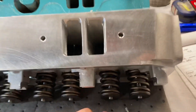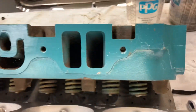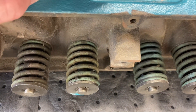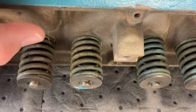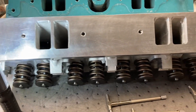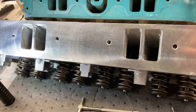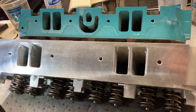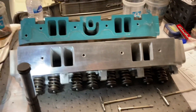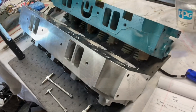Spring diameters are something to keep in mind — the stock spring diameters are going to be pretty small. Usually if you want to go with a higher lift cam you've got to get those pockets cut in there; there's a good Isky article on that. These are stock unmolested 915s I got from my friend Brian. These Edelbrock heads have a lot larger springs so they'll be easier to upgrade with definitely better valves. I don't have the tool today to take these heads apart — I'm going to do that with Ed at his shop and I'll film that for you.